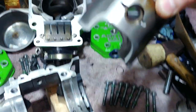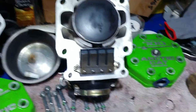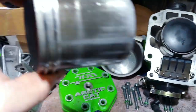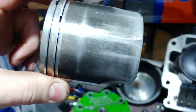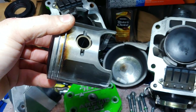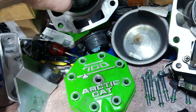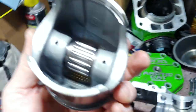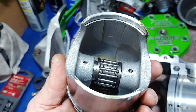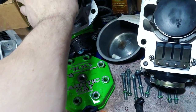I'm not 100% sure about things — I'm getting right about 140 PSI on both cylinders, so it doesn't seem like there are any compression issues. I'm not sure if there's blow-by from idling or what the situation is. The other thing I found was some slight darkening on the bottom of the piston.